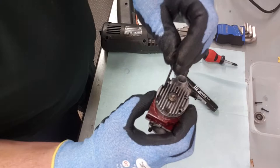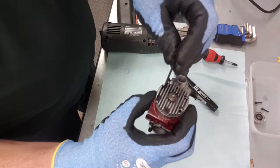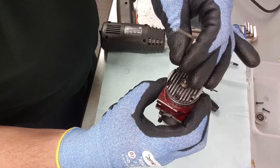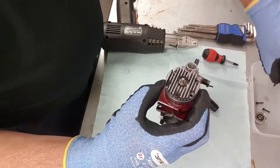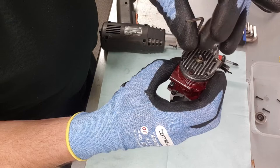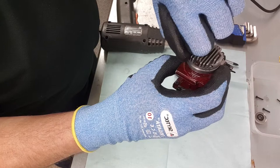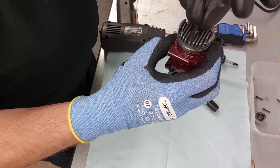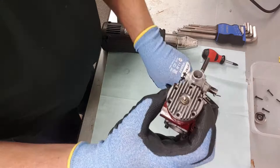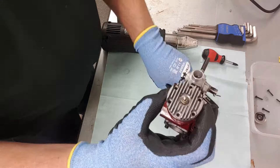The mark looks like it's rubbed off slightly, so I'll just put a fresh marker pen mark on so we know which way around it is. Undo all the bolts — these were really easy to undo, I was lucky we didn't have any tight ones. It's not the easiest job to do with gloves on, but it stops your hands getting messy and you won't get your fingers damaged on any sharp edges. One more to do and this will also show you the condition of the rest of the engine. I always run my engine slightly rich, which tends to save them a little bit.